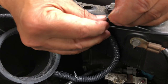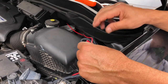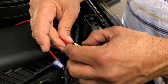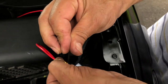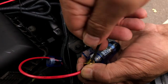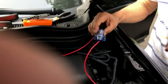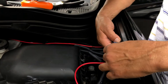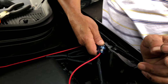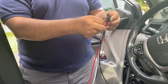Between the Kicker and the battery you have to place a fuse. The Kicker system comes with its own fuse, but I chose to use the fuse from the Bose wiring kit as I felt it was better quality. The best location is to cut the red power cable near the vehicle battery, find a nice spot to place the fuse holder, strip the cable, secure the fuse, mount it, and use zip ties to secure it.